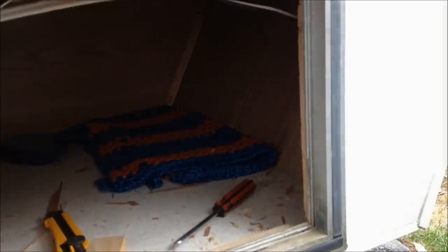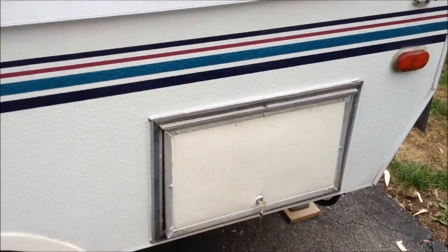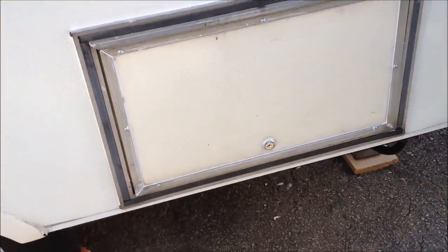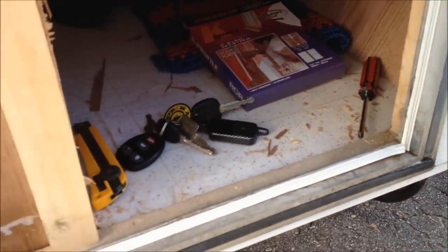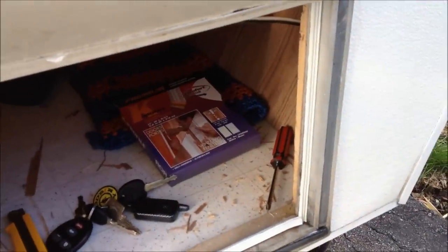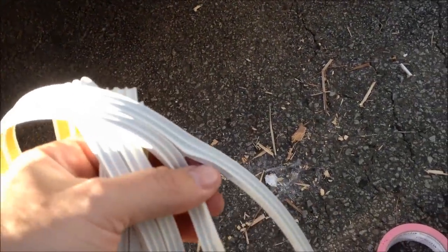I'm going to finish up for the day and get back at it tomorrow, where I'm going to be putting the rubber weather stripping on to seal it out and, like I said, paint it white to give it that nice blended look with the rest of the trailer. Today I put on the weather stripping that goes around on the inside around the contour of the door. It's just a white rubber — typical weather stripping for houses, doors, or windows — but it will work perfect for this application as well. It's rubber, waterproof, and gives a nice tight seal. It actually comes doubled up; I just split it in two and worked it around. Now I'm just going to be masking off the door with some masking tape so I can start painting. Here's the door all painted, looking nice and white — actually a little too white, but it's going to fade over time in the next year or two and perfectly match with the rest of the trailer. Much better looking than the steel frame that it was. That's the end of the project — cargo slash baggage door installation onto a tent slash pop-up trailer. Thank you all for watching, and keep looking for my new videos as they come.